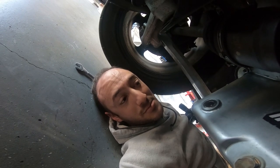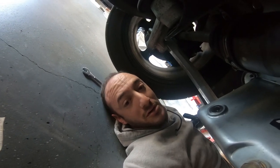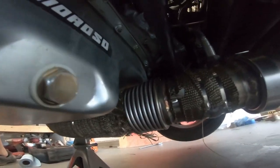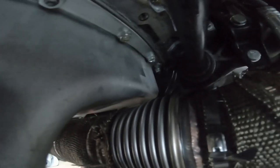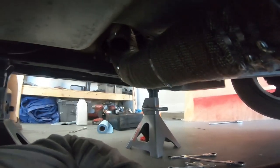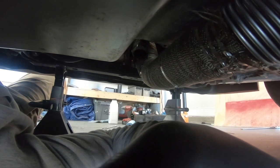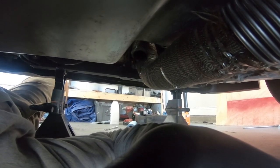For a CRX specifically — car's on jack stands — with a three-inch downpipe and a three-inch thermal exhaust bolted to the car, you have very little ground clearance. I'm actually raising the car a little today. There's some oil pan clearance visible — that's about as much as I'm willing to give it; I don't want the pipe rubbing the oil pan. The downpipe is actually below my cross member. I just re-wrapped it because I had to remove most of the header wrap — it already self-clearanced itself twice and is a little flattened where it gently hit the ground.